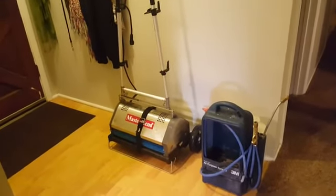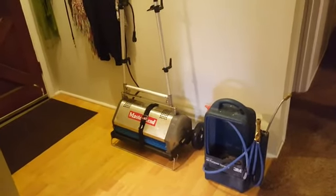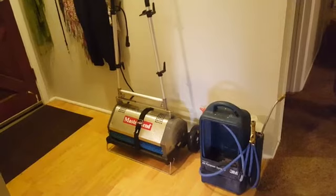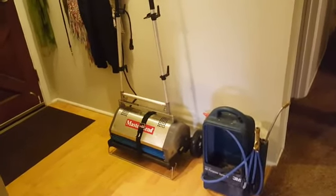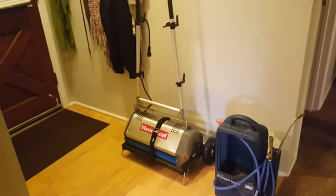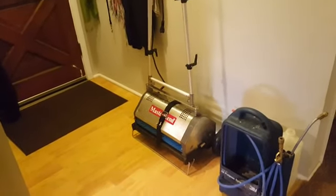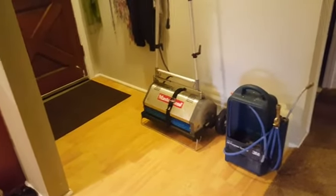I would look at it like, what do you clean most? If you're doing a lot of residential, a lot of restoration sort of cleaning, or just regular cleaning, I would say that this tool is probably one of the most versatile because it's phenomenal on agitation. So whether you are doing restoration cleaning or just maintenance cleaning, the CRB is going to help you out big time with the agitation factor. You put down your pre-spray and then use the machine to thoroughly agitate that solution into the carpeting.